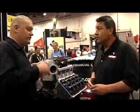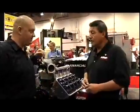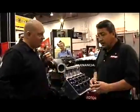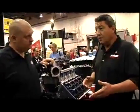When you say 'pull,' you're talking about installing the fastener, torquing it, loosening it up, and repeating that process. Yes. And to build an engine properly, you want to repeat that process until you get the right load. Cycling your fasteners was always recommended in order to try to achieve the proper preload.